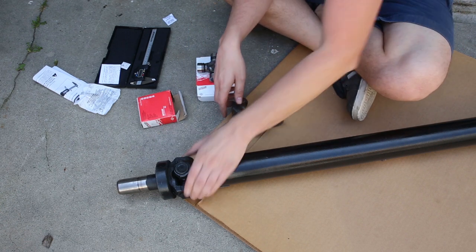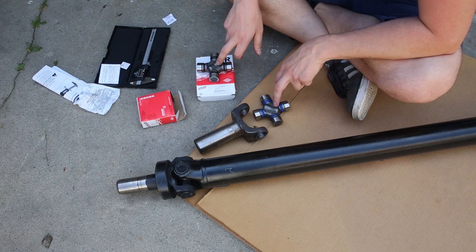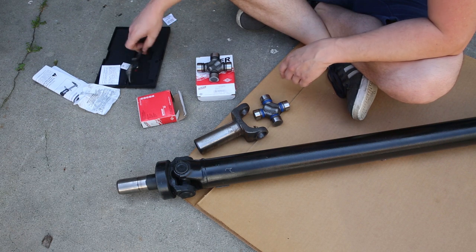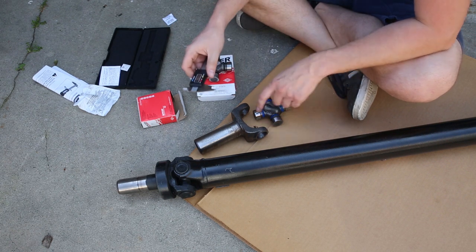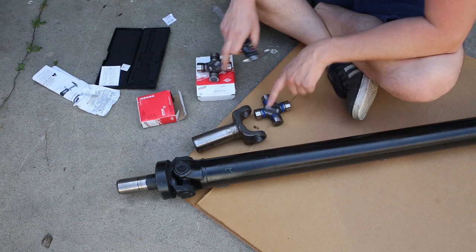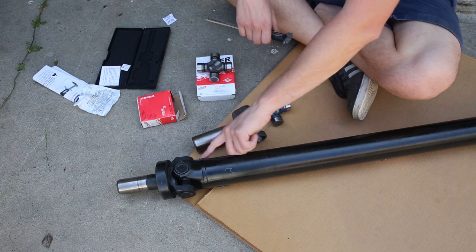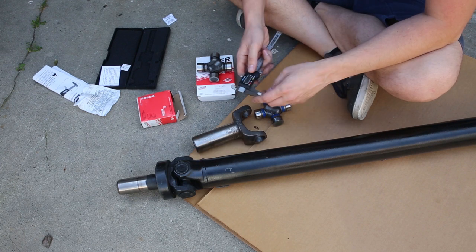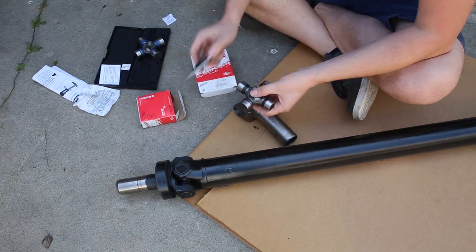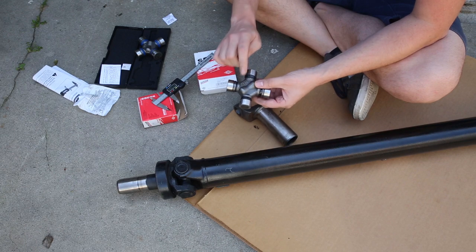So I need to pull this guy off and put this one on, and I also ordered these U-joints a while ago. I don't remember which one works here, so I have my little gauge here, which I'm going to use to figure out the diameter of this hole, to figure out which of these bearings will fit it best, and hopefully whichever one works also works on this guy. So let's give this a shot. So this looks to be the correct U-joint. I'll put the part number in the description below.